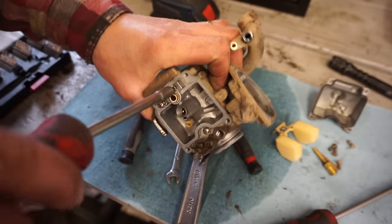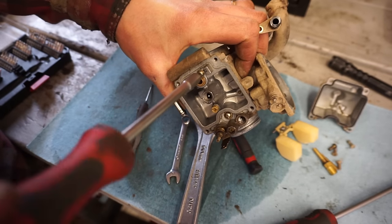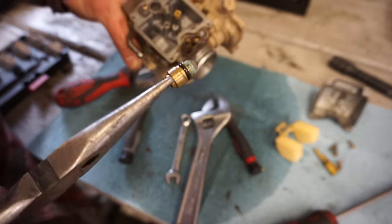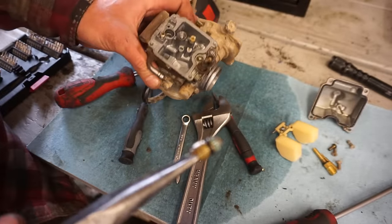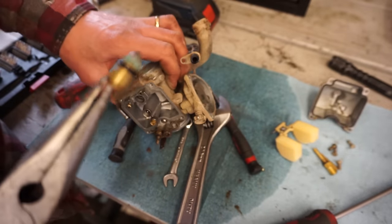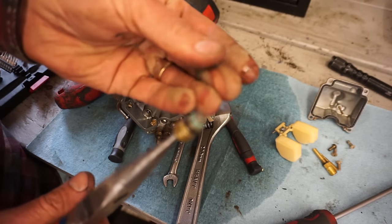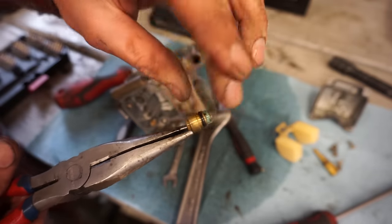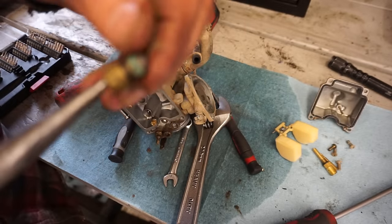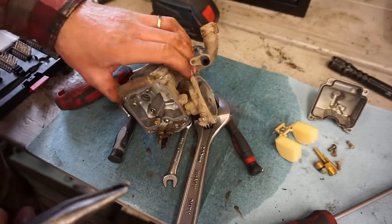Take a look at our seat. Out. O-ring still looks good in there. There's a little gunk in there though. Look at on the end of the filter here. There's some crud. Looks like some sand. So blow that out really good, but wasn't like completely clogged or anything.